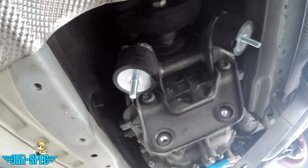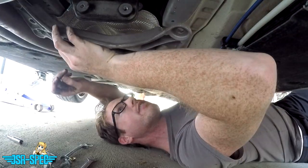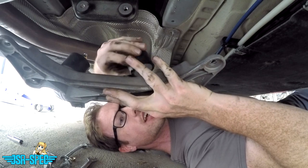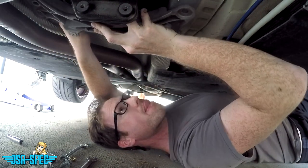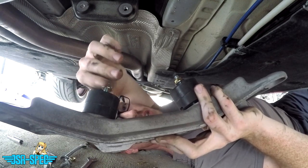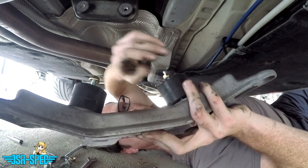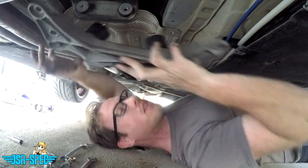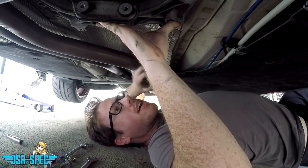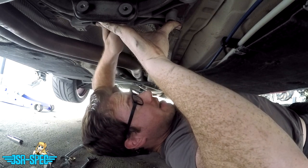Here are the new engine transmission mounts, sitting in place. There are bumps on the transmission crossmember brace that have to line up with those detents. So let's get all this lined up. So let's see if we got this about right. This is where it takes some trial and error. Because of those longer studs, it's a bit harder to get it to all fit up there. Now I think we got that correct. So let me just tighten up the top nut by hand.